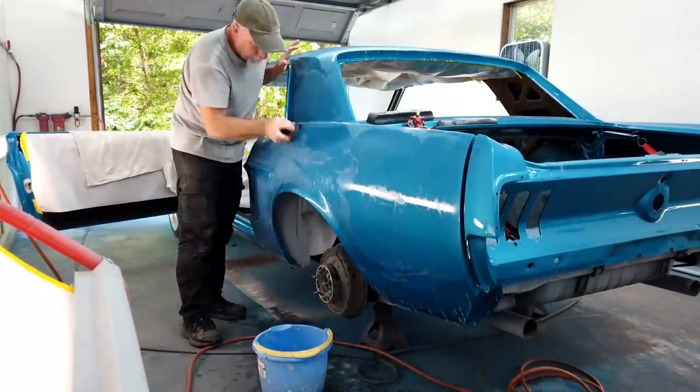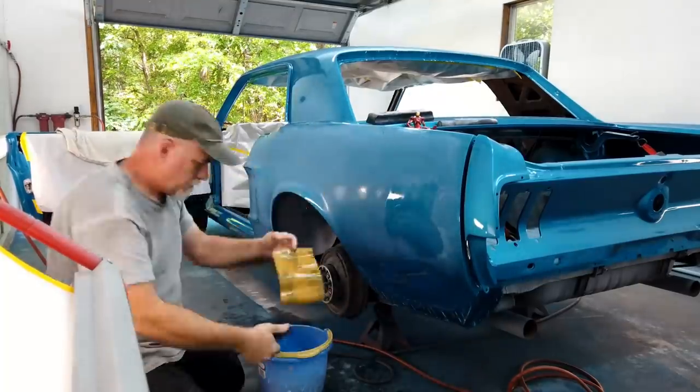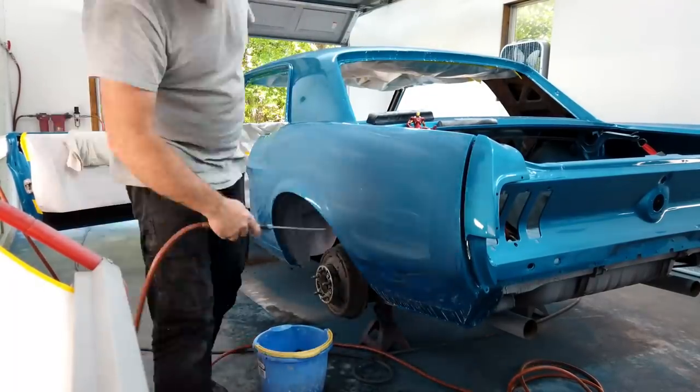And with the time lapse, I may add some voiceover, but I took the long block and went over the big part of the panel. Now, if you see some videos, they'll tell you to sand with the shape of the car, the way the wind flows across the car. Well, the problem is this panel is not flat, it's a curve. So if you're doing a flat like this with a long hard bar, you're actually creating a flat spot. So I do a crisscross, kind of like I'm doing block sanding.